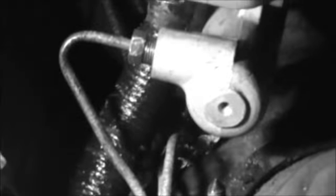But then we'll check our fluid. Still good. If it kinks or breaks, do you have to replace all the lines or just that one? You would just replace the line that you broke. And then you'd have to rebleed the system again. Are we going to have to do the brakes? No, because we bench bled this, we shouldn't have to bleed the brake calipers, but it's good policy to do that. Because even little air bubbles in your system could give you a spongy brake.